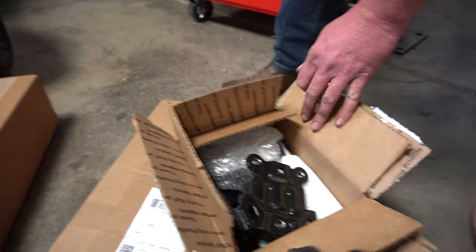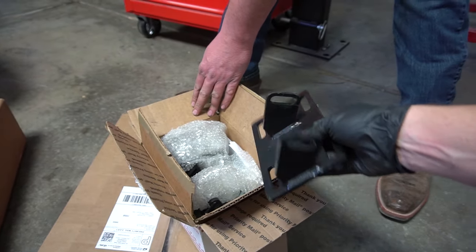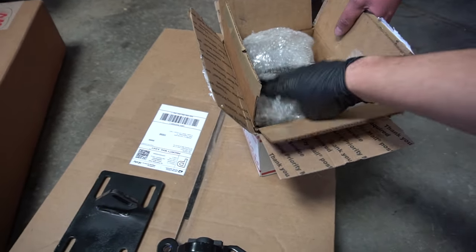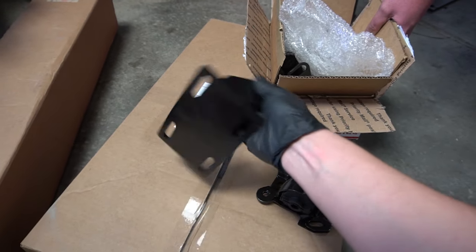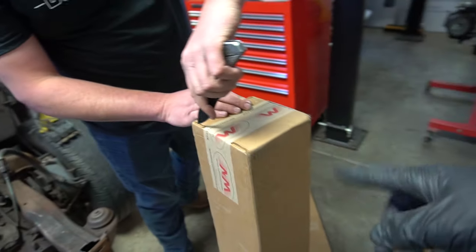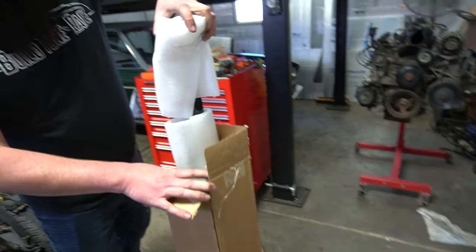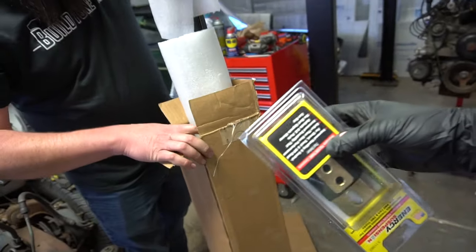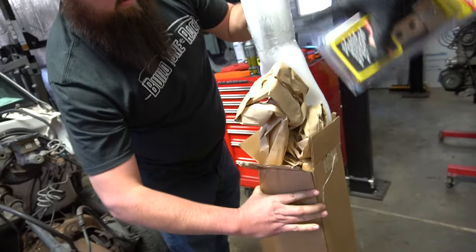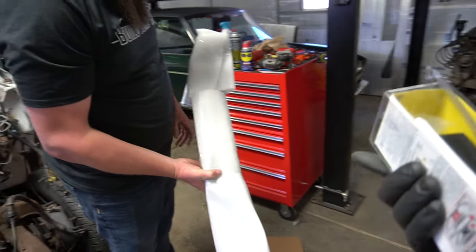These are the engine mounts, just got them off eBay - comes with a stock 2.8 mount and then the slider mount. These are the ones that Motion recommended; talked to Doug. The transmission crossmember is what they use to design around, so it's pretty much a stock mount and then the LS mount with the slider so you can adjust it. This is the transmission crossmember mount for a Powerglide - it also bolts right to a Turbo 400, Turbo 350. If you want to do a 4L80 it's a different mount. This is for Turbo 350 and Powerglide - the mount we needed.